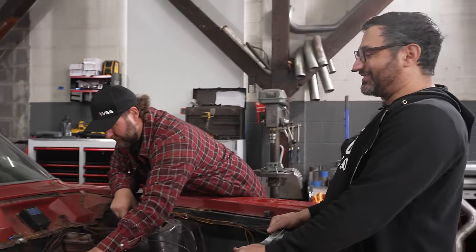So they're big block to Ford adapter? No, the 302s, they're just small block like mounts. The small block ones come up higher and then the bolt goes through. We have the isolator that bolts to the motor. This is just the frame mount, the pedestal. Gotcha. We do have to make a trans cross member because there's nothing back there. Easy peasy, no big deal. We've got two trans cross members in the trunk holding the fuel tank in. Yeah, perfect. No big deal.